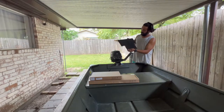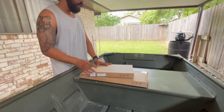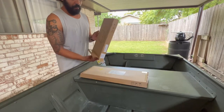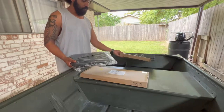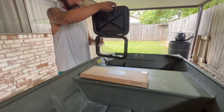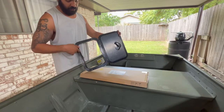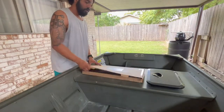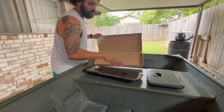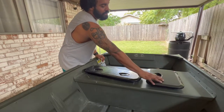So these are the hatches from Seaflo, all from Amazon. The price looked good, they have good reviews, and I got them in black to kind of match the boat and the trailer. Seeing these, I kind of regret not getting lockable ones, but whatever. So it's one hatch — that's the size hole you're gonna cut. I got 24 by 9.5 inches and this one is 14 and three quarters by 10.6 inches.